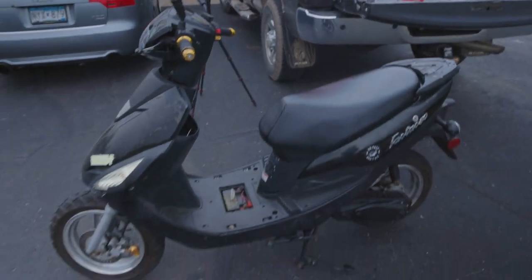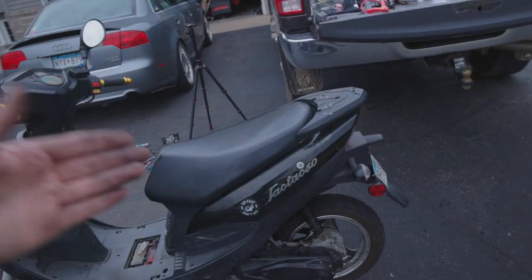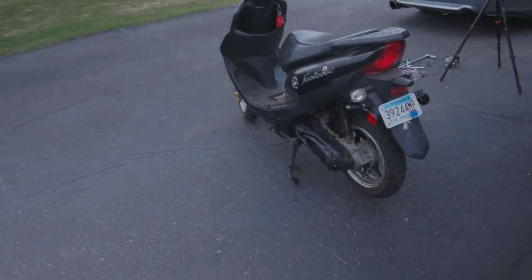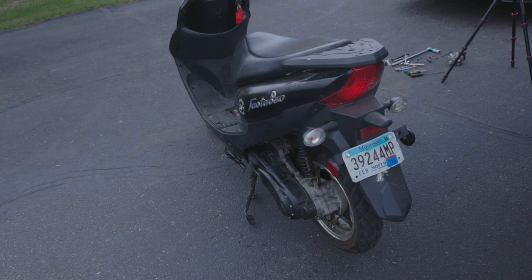It's starting to rain — perfect timing, that's where I'm going to leave it for today. There's going to be more scooter stuff, I promise. Tell me what you guys think, because I want to know more and you guys do have a lot of knowledge. Let me know what I should try to change next to get it to go faster. Oh — I forgot — it also has the gear up kit, which could be a major problem. When we put that in it did go faster, but it took so much extra effort. I think more power is just the answer — maybe a 100cc name-brand big bore kit.